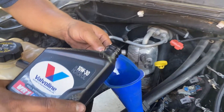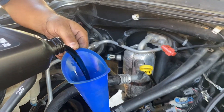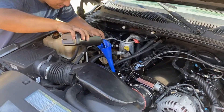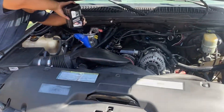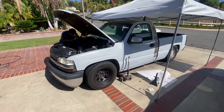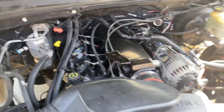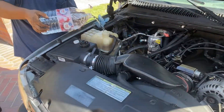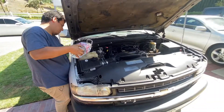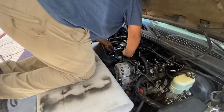All right, there we go — putting our oil in. Got that blue VR1 oil, blue funnel, blue oil — it's only right. We just need that Valvoline sponsorship. We'll go ahead and get the rest of that oil in, then get some coolant, and fire it up. We're going to go ahead and fill up with some water first, just in case we have any leaks — checking with water first, pretty sure everything should be fine though. Got all our oil in, top it off and we should be good to go. As far as all mechanical mods, that's pretty much it — we got everything hooked up, doing some last-minute checks making sure everything's nice and tight, all our hoses and fittings. The last thing we have is pretty much just wiring up the E85 sensor, but it should run fine without it for now.